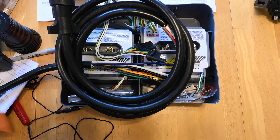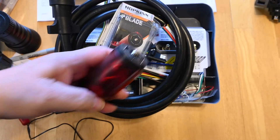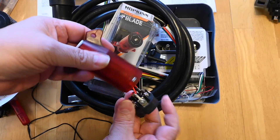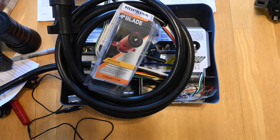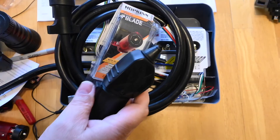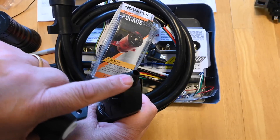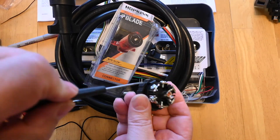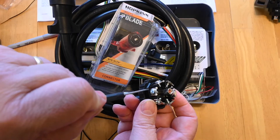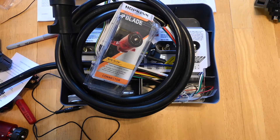Hopkins also makes a couple of cool 7-pin blade connectors. This one here has an LED in it — the LED is between the taillight and ground, so when you turn the taillights on, the LED shines through the red housing so you know that you have connectivity. They also make a pistol grip style, and what I like about this versus ones like the Curt is that this will be fairly waterproof if cut correctly. And the connector out of the pistol grip style has the functions marked rather than the color code or the pin number. So in my view, Hopkins is going the right direction. These other guys, not so much.